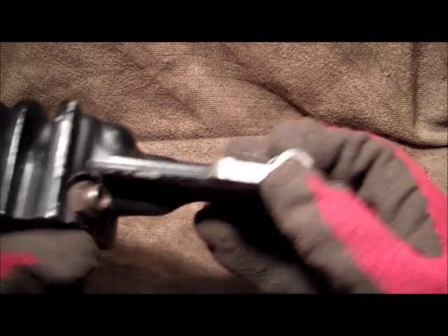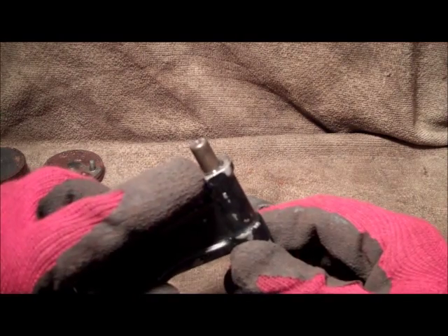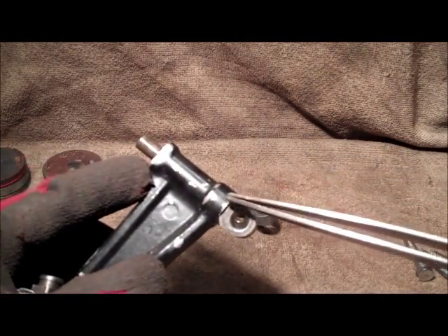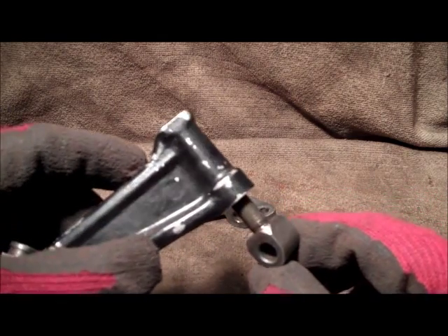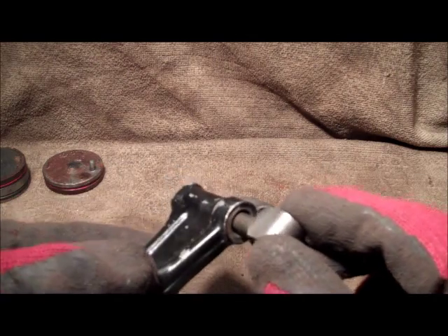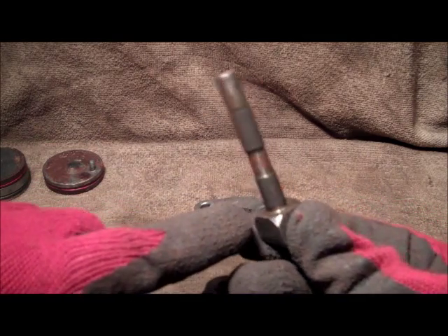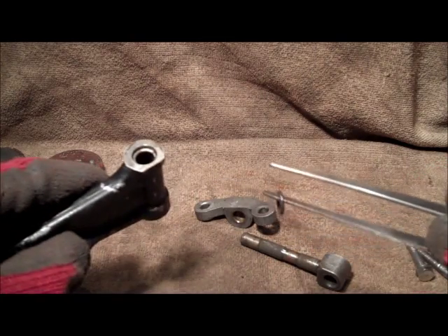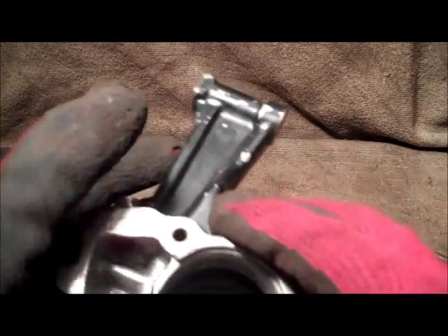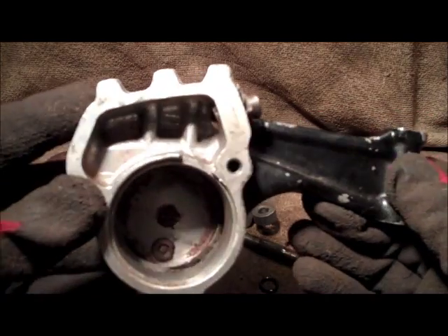The next bit to check is this arm, which allows the unit to slightly fluctuate if there's any alteration in your disc. The top piece comes off. There should be an O-ring at the top here and at the bottom here. If I remember rightly from the last time I worked on this, the O-ring at the bottom had failed and I couldn't get hold of a new one, but I've got a replacement now. So I'll take that out - there's a bit of rust starting in there, so I need to get that cleaned off. There's also a little other O-ring, which I've got a replacement for. We'll give this a thorough clean and tidy, and that should be ready for reinstallation.